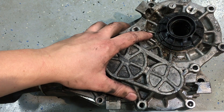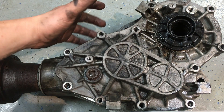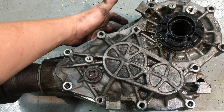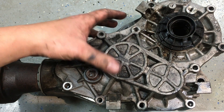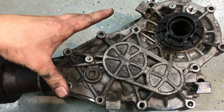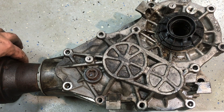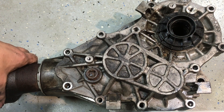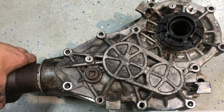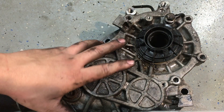The way these work is very simple. They literally bolt up and are directly splined to the transmission, so whenever the vehicle is in motion the gears inside are spinning. It goes out the output flange to the rear driveshaft and then to the rear differential, which is where it decouples from the system until it needs all-wheel drive operation.